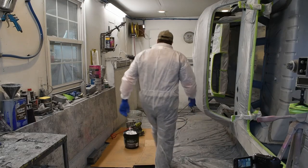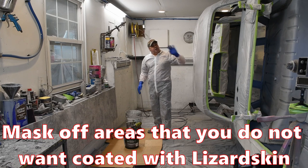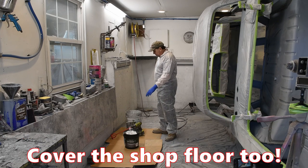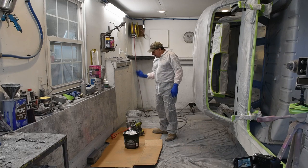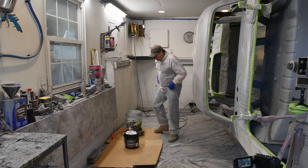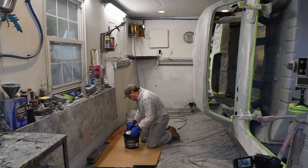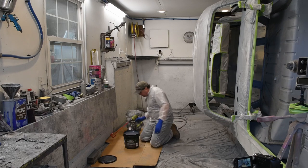All right, folks, so here we are. Got my car set up on the rotisserie. I've taped off everything in the car. I've got my Lizard Skin, my agitator, my bucket of water, and my spray gun. So what I'm going to do is go ahead and open this up, and I'm going to agitate this. Looks like kind of a purpley mess.